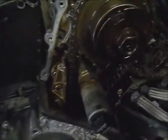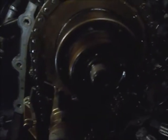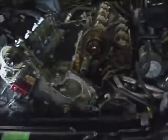There's a hex head on the back on the intake cam and up front on the exhaust. Take that nut loose — the threads on this side push toward the inner side, and then pull toward the fender on this side. All bolts go in this direction. Be sure you lay your stuff on the side you took it off of. I've loosened all four of these bolts a half a turn.